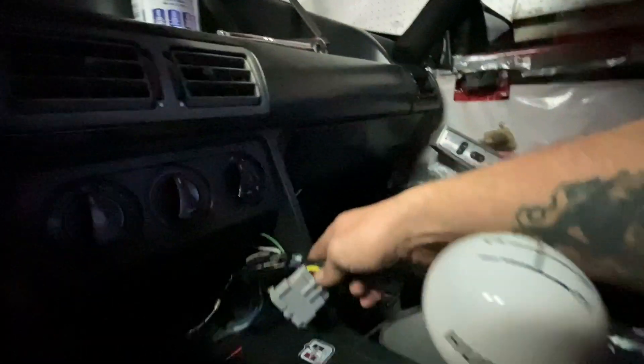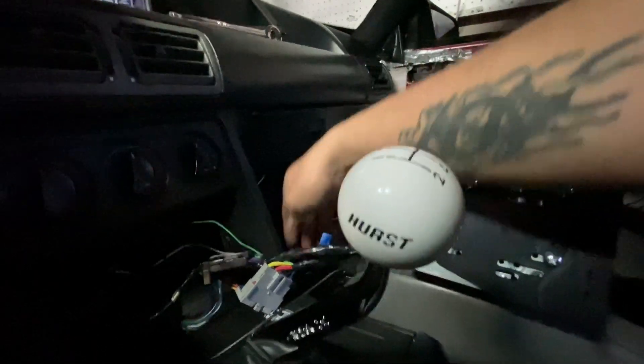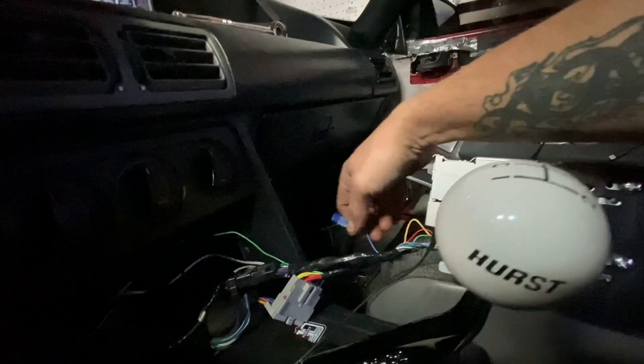I'm going to button up all the wiring, get it nice and neat, then start putting the brackets on the sides of the radio. I've got the brackets on — there are two brackets, one on each side. Wiring is cleaned up as nice as I can get it. I left access to the remote wire in case I put a sub in later. The car doesn't have an antenna right now because the fender is shaved — I need to get one of those wireless antennas, so we'll deal with that later. Now we'll tuck all these wires back and get the radio sitting in position.